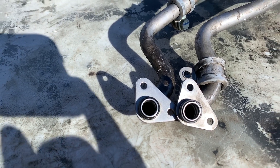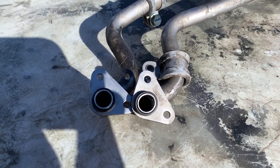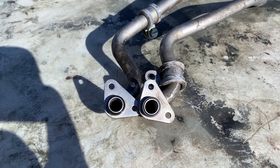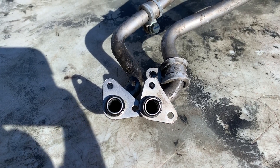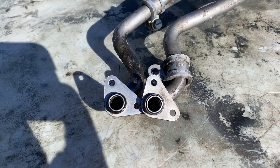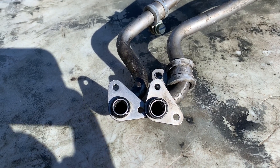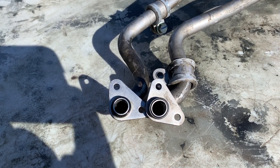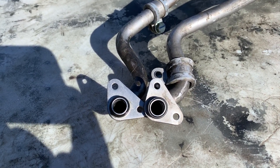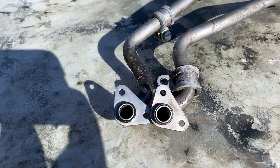Hopefully that's it. I didn't even think about looking at this - I never pulled it off so I never thought there'd be a problem. The bolts were snug, but as soon as my son put fluid in the reservoir tank it started dripping out quick. There's a turbo intercooler pipe right there blocking that top bolt from getting a good straight angle, so I used a quarter-inch drive number 10 socket with a swivel joint and just barely got it loose enough to work out with my fingers.